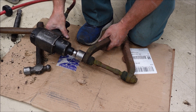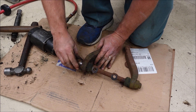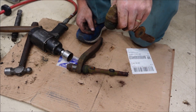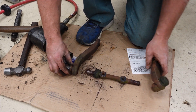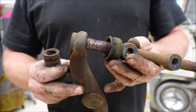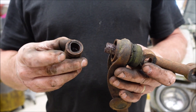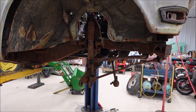Let's smack her around a little bit and see what happens. It's a cap, just like the other bottom joint. Look at that — woof, worn out. So what we've got is this shaft, a dust boot, this piece right here that'll slip on there, and then our cap that threads on to the outside. There's a rubber bushing inside. This is not going to be it for the front end — we have more to do, but this is going to be my stopping point now. Let's look at the rear brakes.